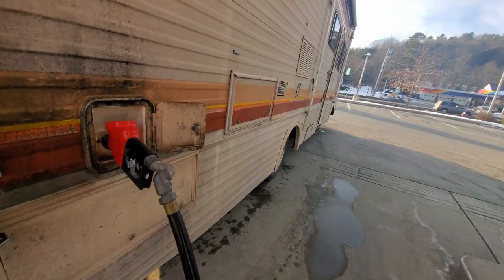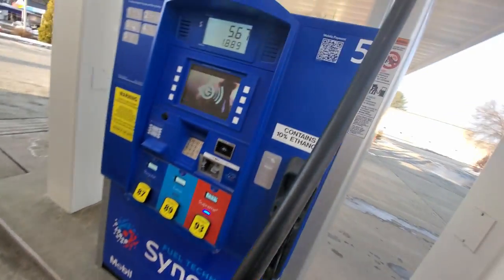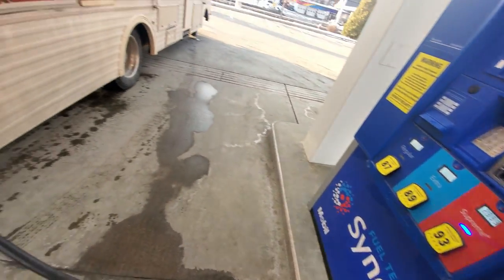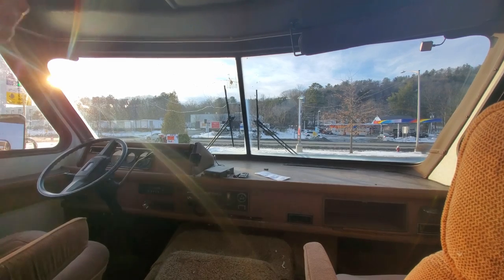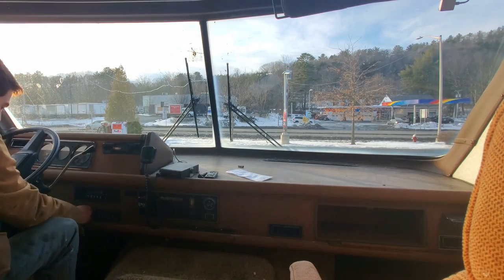The camper was doing a little bit of dieseling and backfiring when I turned it off. I'm going to try solving that by first just putting in a bit of 93 octane fuel and see if that fixes it. If not, we'll have to adjust the timing or whatever. Let's give you guys a look at the driving — let's hope it starts back up. With the old starter it wouldn't, but with the new one hopefully it does.